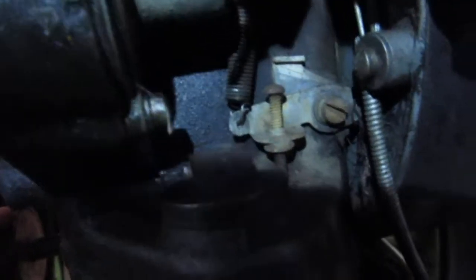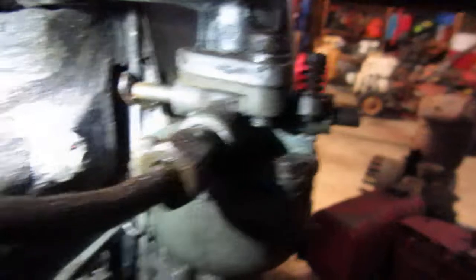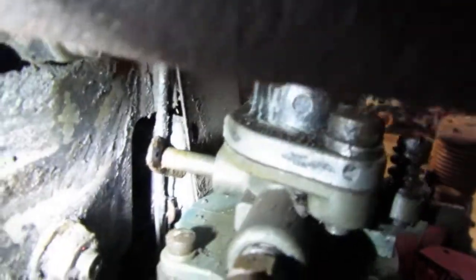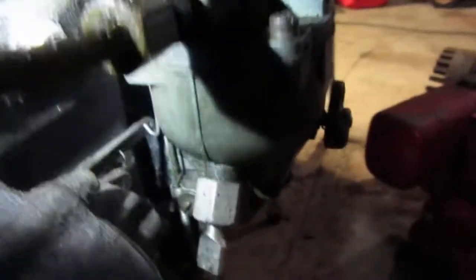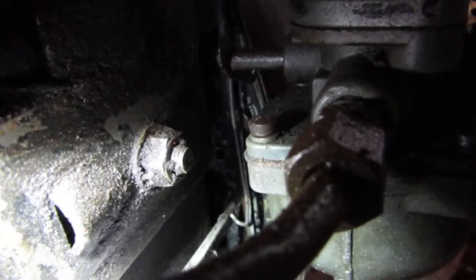Here is the mechanical part — see that little arm back there. It's in about the fourth hole. You have to have a spring that goes down to that right there, and then your throttle cable clips right there and then goes up and hooks inside there. That arm — this spring right here — goes up and down, and that's where your throttle cable hooks to. There's a little hole there that your throttle cable goes into. Then you have a governor arm that hooks to the back of your carburetor, down to that governor arm.